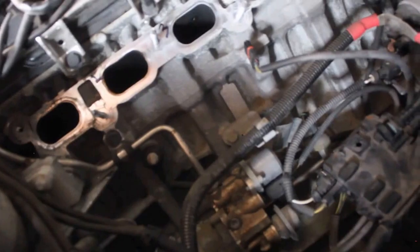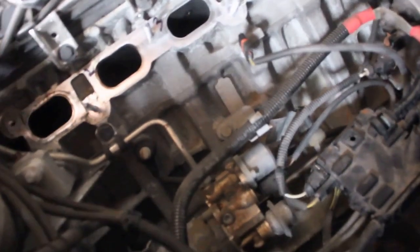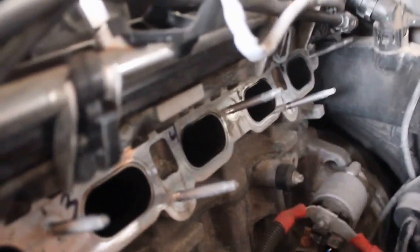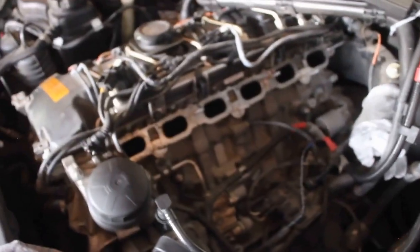I just plug that thing back in and you're ready to go. So you grab this cable because you unplugged it - you unplug the throttle body, so you make your own cable. You just bump it right there until your valves are closed for whichever valve you want to walnut blast.